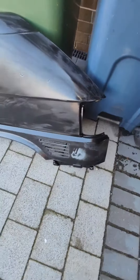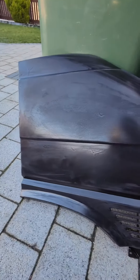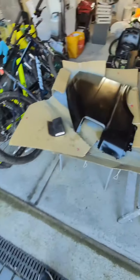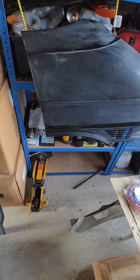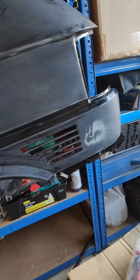Just some 400 grit paper on a block. There's my other one — see the run I had last time, I rubbed it out. I'll give that another quick sand because there's a couple more to take out and then paint again, just so they go on the van and don't look horrendous and blend in a bit. The wing is all rubbed down — took the snots off, if you like.